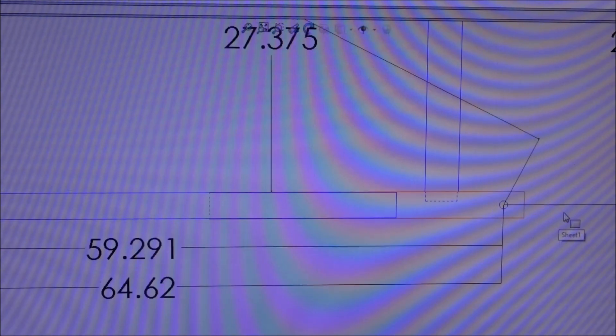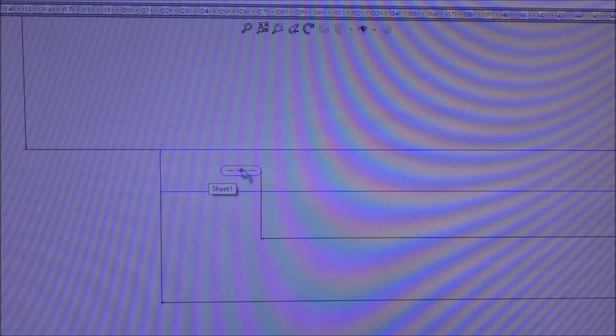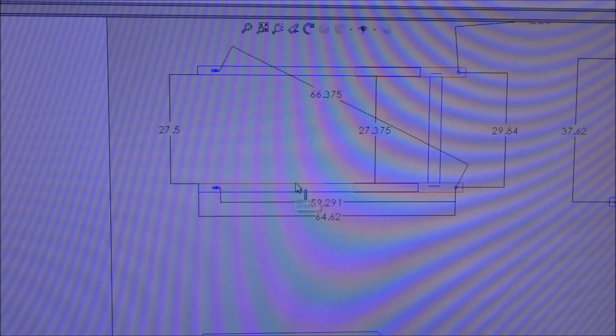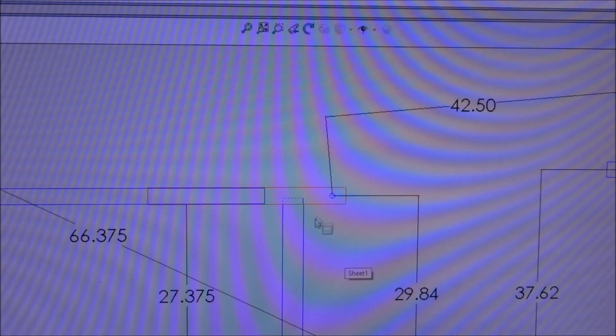From the center of the four-support hole on the same side to the rearmost center edge of that elongated hole, I got 59.291 inches. That'll just help me get the frame rails into their pockets equally on both sides, because everything on this build starts with the four supports being in the correct spot.